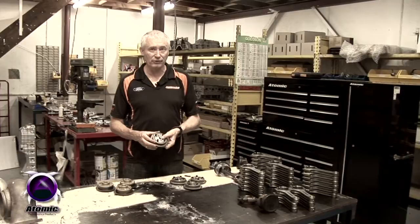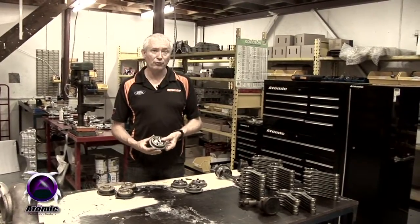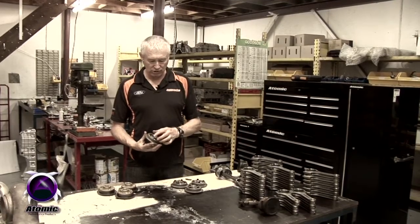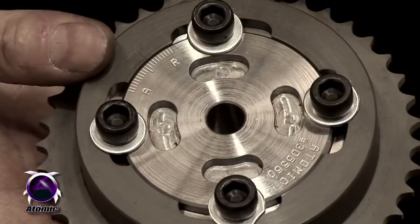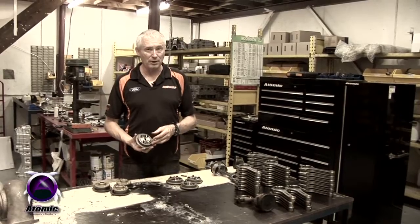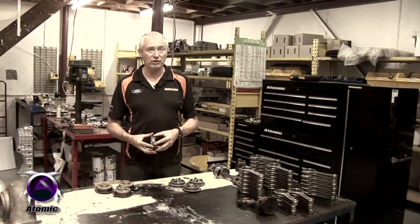It's very simple, very straightforward, and easy to use. They're made out of 4140 chrome moly steel. We gas nitride these sprockets for durability because there's a chain driven camshaft in these engines, so there are no aluminium components which would flog out quite quickly in a chain driven environment.